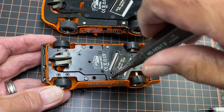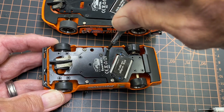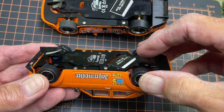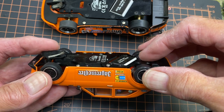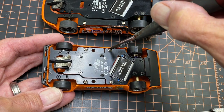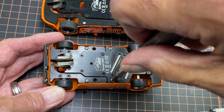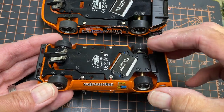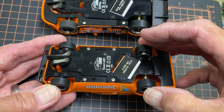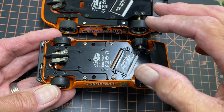If you tighten these down all the way — maybe about three-quarters of a turn — that's it, there's nothing. I'm forcing it to move just to flex the body; that's not float. So I'll back it off a little bit — there we go, now I have float. That's why the car ran as smoothly as it did in the video. It's just a design change, an odd one, but you know.